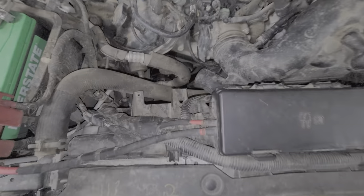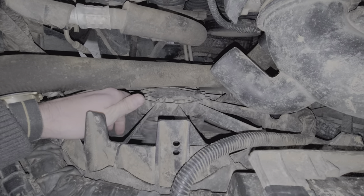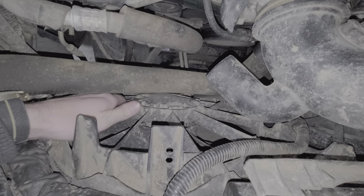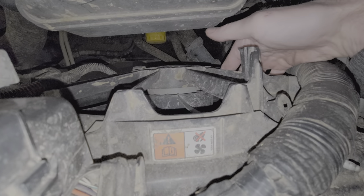I'm going to show you the location of the different cooling fan fuses and relays, but right off the bat I want to mention one of the first things I like to do when troubleshooting the cooling fans is go and check if I can turn the fan blades by hand. If the fan blades won't spin by hand, that's a pretty good indication that the motor is probably seized and I should just go ahead and plan on replacing it.